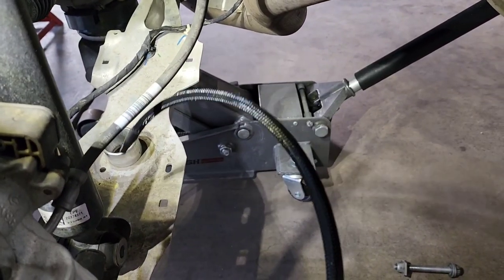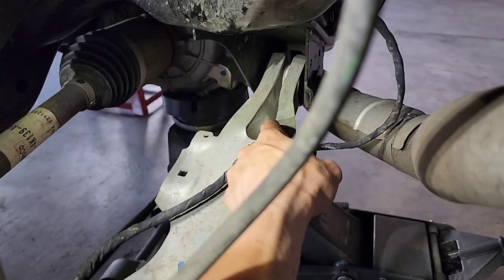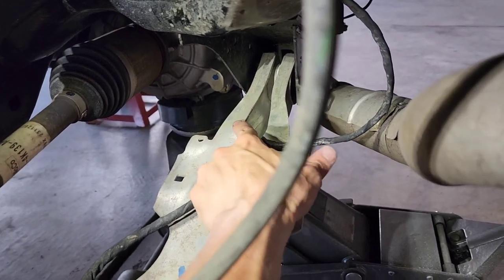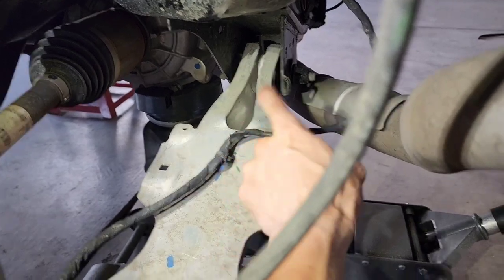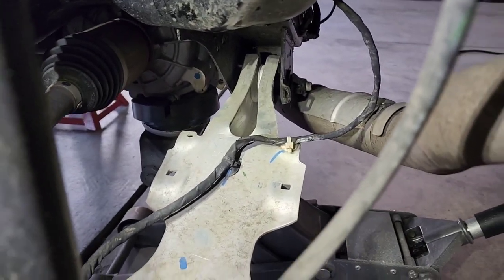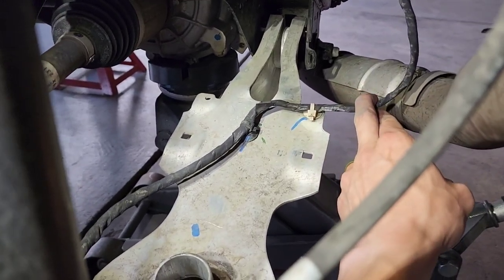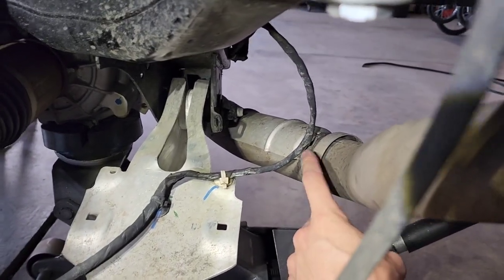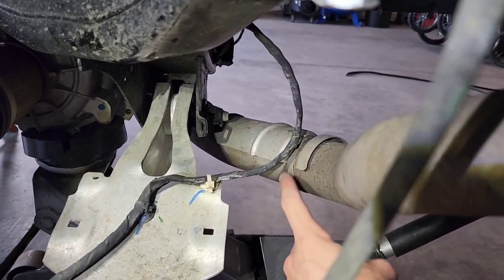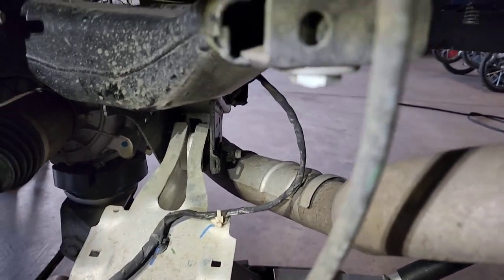All right, I got two layers of that wire loom on here for just this section that's gonna go through the lower A-arm. I took a file to the inside and top of this lip to take off that hard edge. So it really shouldn't be sharp there rubbing anymore. And I'll probably route it up along this. So obviously this is out of the way of the suspension by the factory. There's already a heat shield on here. There's two little heat shields provided. That's what those little plates are for. You could bend them, attach them to wherever you need. So we're gonna do that.